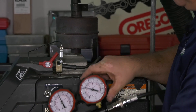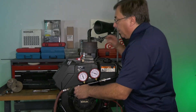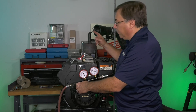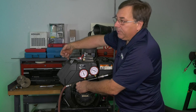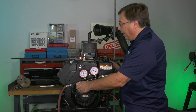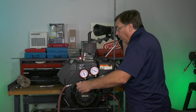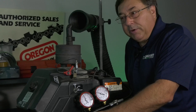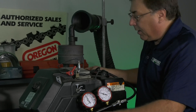Now we've got to determine where that leak is coming from. That's as simple as putting your ear up to the exhaust system — do you hear any air coming out? Removing your air filter and listening to what's coming out from the intake side, whether we have an intake valve leaking, or pulling the dipstick. You can actually hear air coming out from the dipstick on this engine.